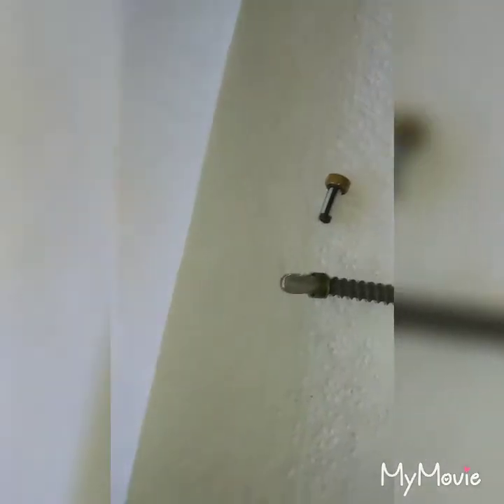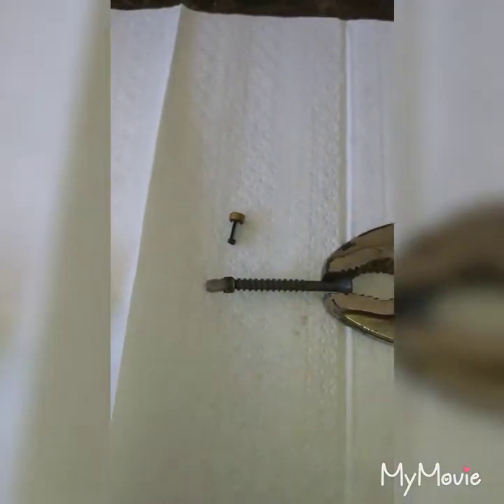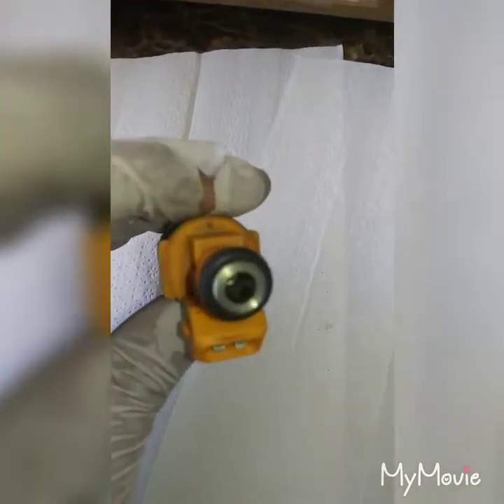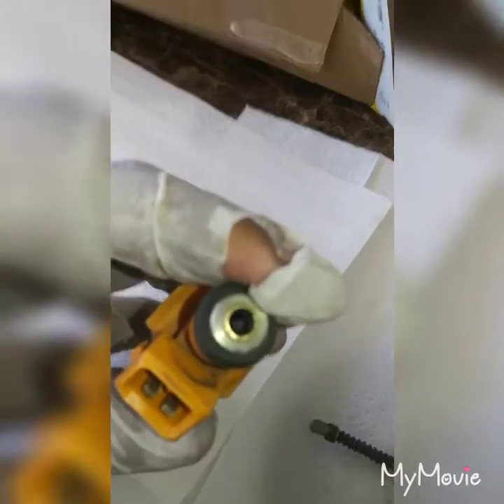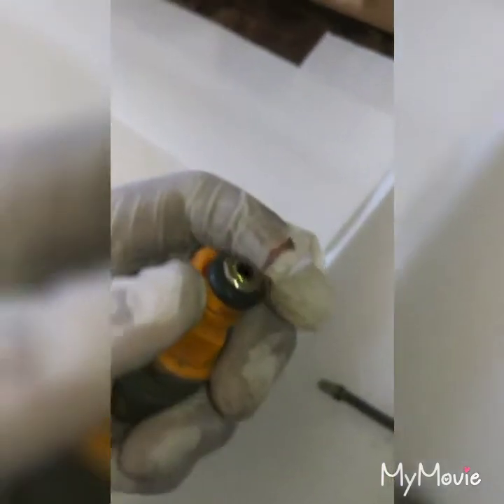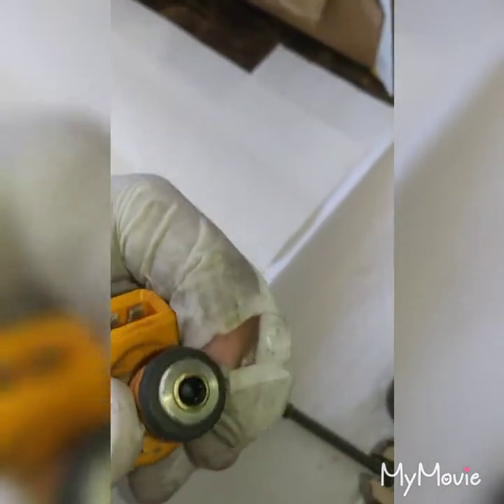Here's the filter taken out. I just shoved the screw in, twisted it not even a quarter turn, then wiggled it back and forth and pulled it out. I'll spray some carb cleaner in there to spray any debris out, then move on to the bottom. For the new filter, I used a flat-sided hammer, just tapping it in — don't put too much pressure, just until it's flush against the surface. That's it for the filter part.